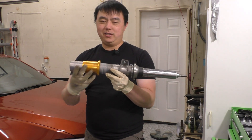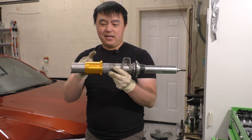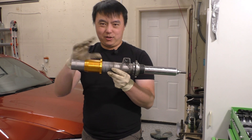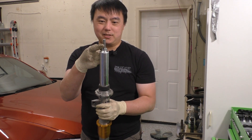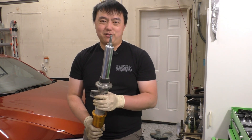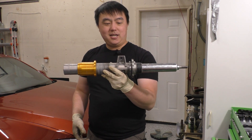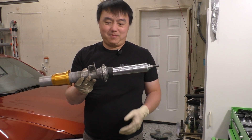The reason I say that is we know that where the knuckle clamps is this aluminum collar here, and the difference between an F2X/F3X front strut and the F8X is the diameter of this collar — 57 versus 62 millimeters if I'm remembering correctly. So by just swapping this collar, you can make up the difference and install it. We also know that the top on the Ohlins is an M12, which is the same as the F2X and F3X, and they're using a nut with extra shimming for the 14mm or M14 thread top mount of the F8X cars. That would be an easy way to keep commonality and lower costs across these platforms. Anyhow, we've taken a look inside, seen the short bump stop, and really there's not much else to it because it's a pretty simple assembly.